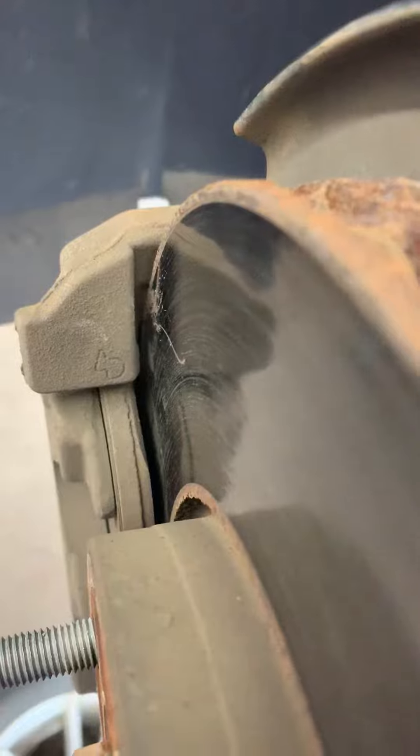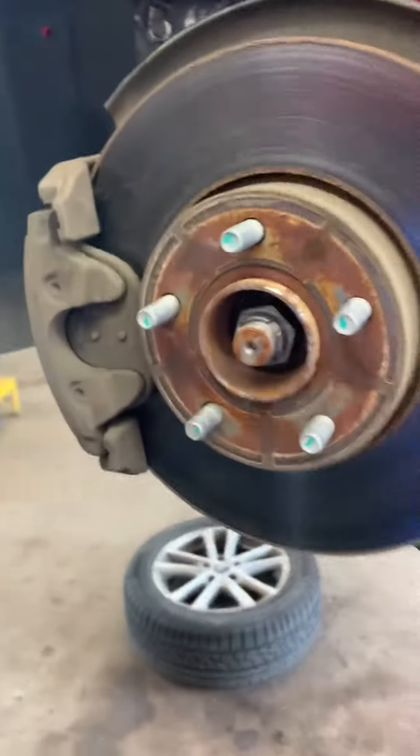As far as pad thickness, you can see a lot of pad remaining. But overall, to do a proper repair, you need to do two calipers, two hoses, and rotors. If you only did one caliper, the downfall would be possible noise, uneven wear, and a possible brake pull — where when you apply the brake, it could pull to one side because one side is working at 100% and the other is now worn down to about 50%.